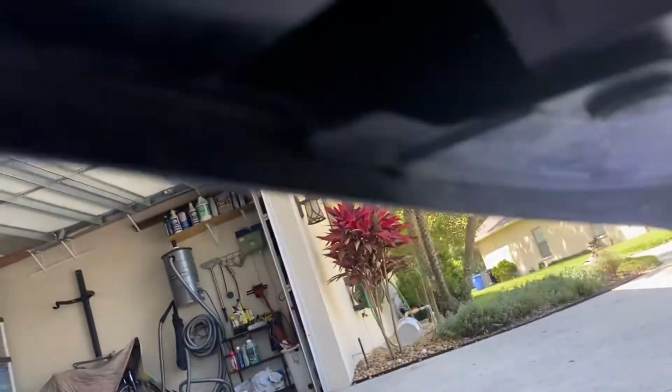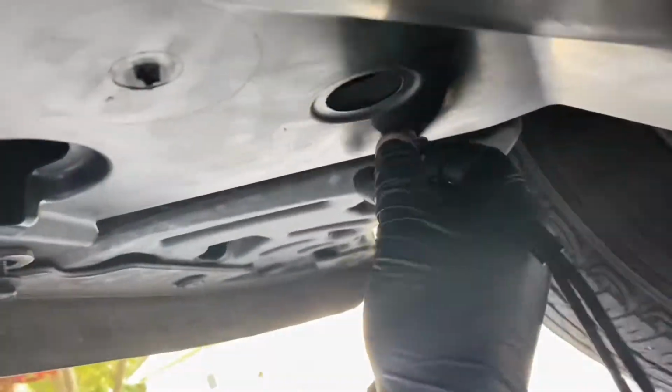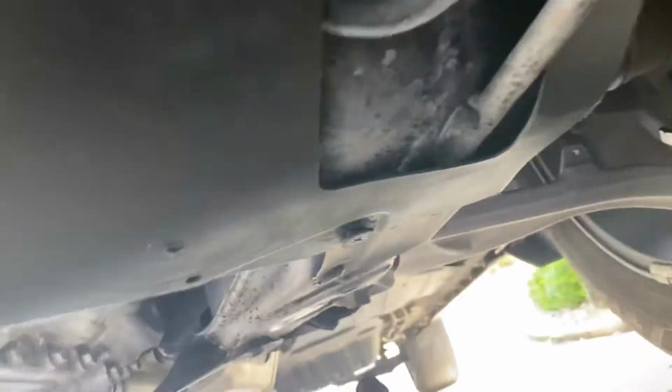And then the 2 long bolts, this is how I had it pictured, is it's this layer, then this little thing here, and then the splash shield is on top of that. The long bolts I put in here, I think they'll go. And then the silver bolts right behind it, right here. And then the Phillips head is at the furthest back point right here. And then everything duplicates on the right side. You got the Phillips head, you got the silver head, and I got the long bolt right here. So long, silver, Phillips, and then the 4 short black ones went in these 4 cubbies along up front here. 1, 2, 3, 4. And everything should tighten up and work well.